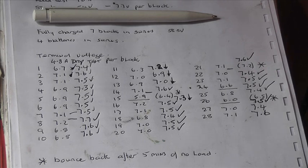So we're going to either have to take it apart, or do some cross wiring. And I think we'll do some cross wiring. We'll just take those out of circuit. So effectively, instead of having 4 packs of 7 cells, we're going to have 3 packs of 7 cells with a few duff ones just left in there and a couple of good ones. We'll just have to let them sit there. But that's how it is.